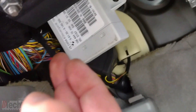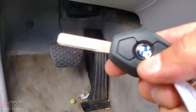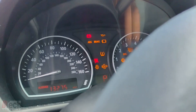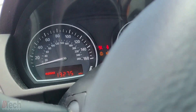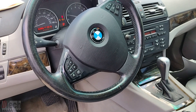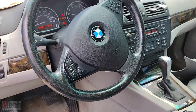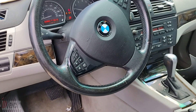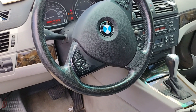We're out at the vehicle. The EWS is plugged in — it's just hanging — but I've got the original key that came with the vehicle. The vehicle starts again as it should. It's all the original EEPROM immobilizer information that is now transferred and cloned into the donor unit, so the vehicle knows no different and it'll start and run as normal.